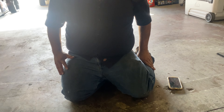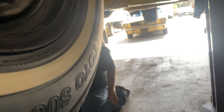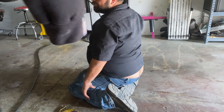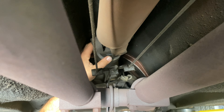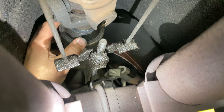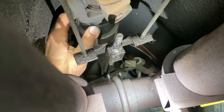Take a look at this — your passenger side lower control arm: the arm is actually touching the bracket. See that right there? That's because the bushing is starting to walk itself out. You can see it right there — it's starting to kind of walk itself out.